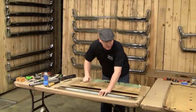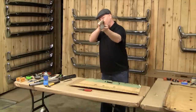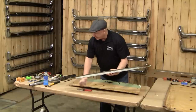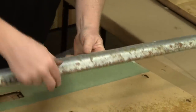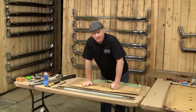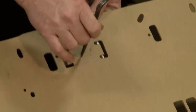All right, that's the last one — we have all of these pushed back up, and we're going to do a little bit of straightening on the vise before we press it out. The next thing we want to do is get all the rust off — it's not rusted through but it's definitely seen its day of moisture. We'll do both sides in the media blaster, bring it back, get it over to the vise, straighten the piece out, get it prepped and ready for the new panel. At the same time, we'll go ahead and punch out this, which is for the courtesy light on the '67–'68 — this needs to be taken out.